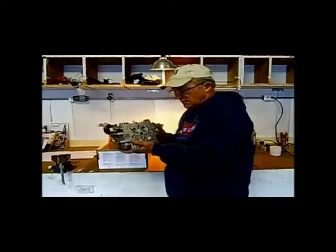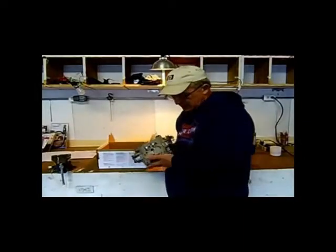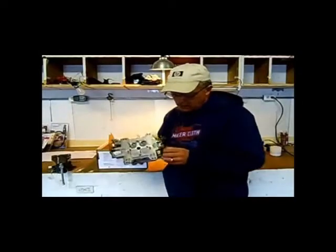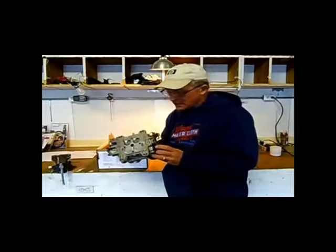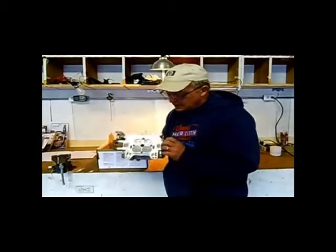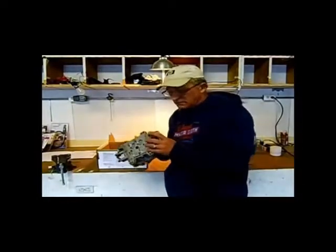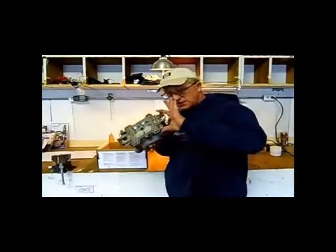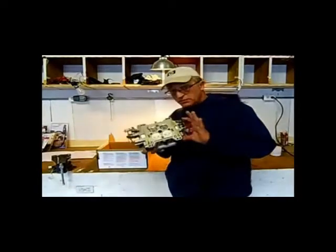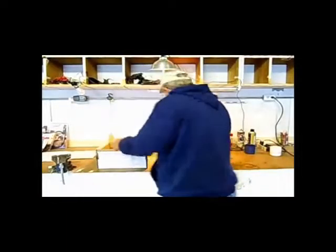When you work on these carburetors, you're going to need to make sure that this throttle plate is all the way closed. There's linkage on the side of various configurations that you can see that throttle plate. Here, I'm going to move the linkage here. This is the fast idle cam. And you move it that way, you set the throttle screw down. You have to look at it until the plate is completely closed. At that point, you're ready to groove. You may choose to take a zip tie or something and tie this area back to where you know that the throttle plate is not going to move while you're doing the groove. That's the carburetors. Okay? They're all basically the same.